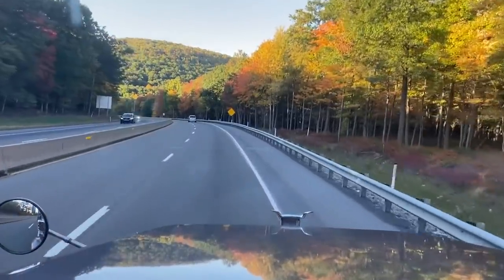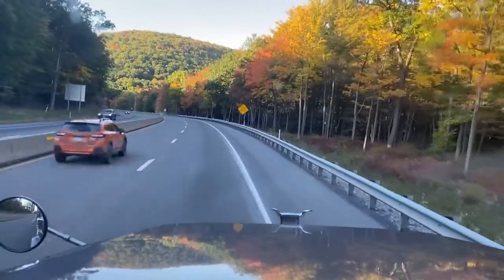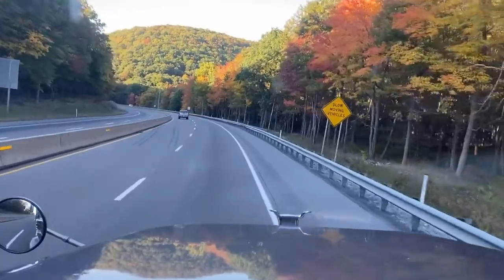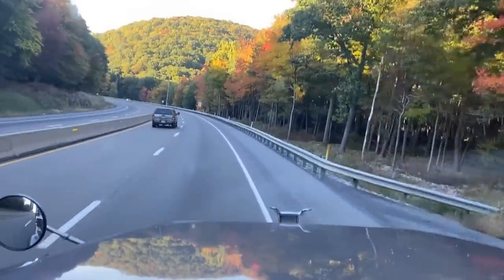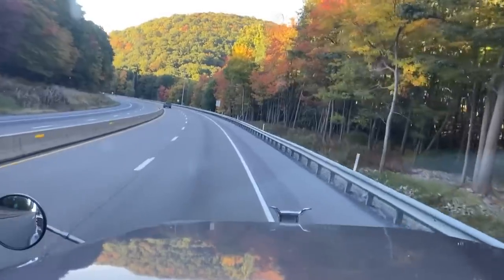As you see, the jake is starting to kick in now. Let the jake do the work. The purpose of the jake brake is to take excessive work off the brakes. The jake may not fully support the truck, but instead of using the stab braking technique, the jake is there to take work off the brakes — it's to save your brakes.